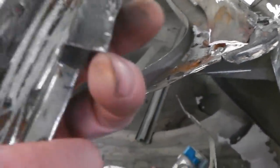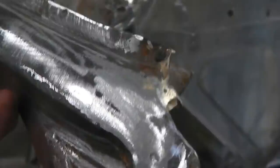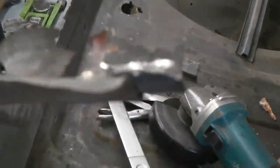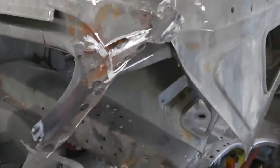Okay, the extraction is going good. We've prepped up the piece of donor material. Here it is, salvaged from that panel as I just explained, and I've now broken it away in a shape that's going to suit the repair. You'll see there's some braze on it. That's where it brazes to the quarter, the rear quarter, to the corner of the window. So you've got quite a few braze joins on the quarter. For example, on that B-pillar there, look. Certainly there's lead at the top and there's braze in that corner. There's actually braze in every intersecting corner, even down here where it reaches the back quarter, rear tail light area. More braze goes in, so each join point is brazed in on these wings.